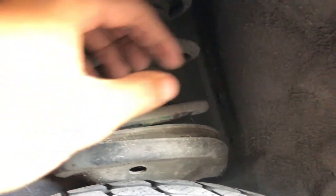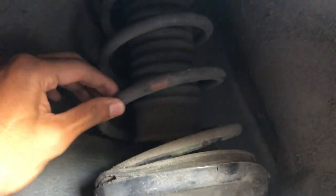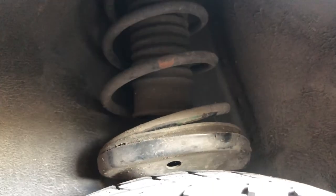I started to jack up the rear right and I noticed the spring is already in position — I don't think I need to adjust anything. The end of the coil is inside the notch, which is where the spring ending is supposed to go to secure it. So it's already inside. I'm going to leave this side. It's not even shaking. Let's move on to the front right.